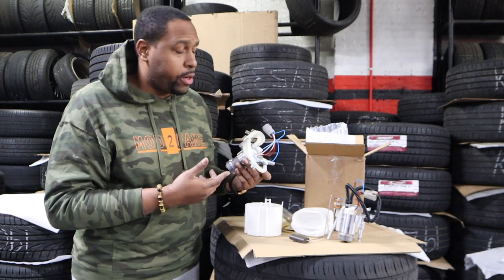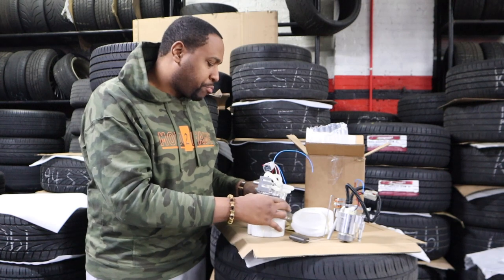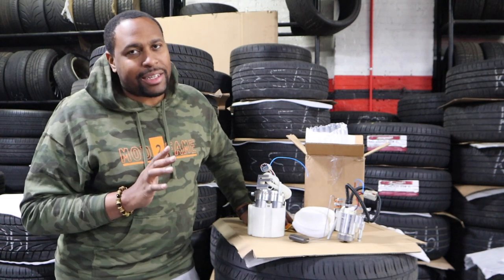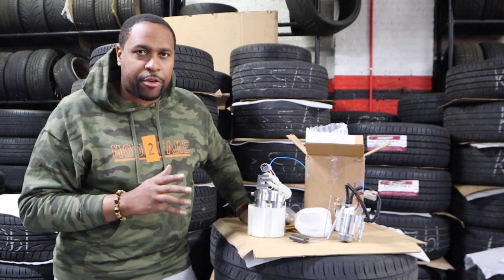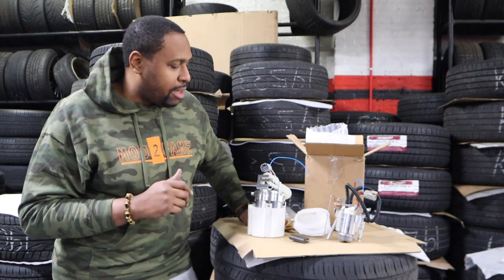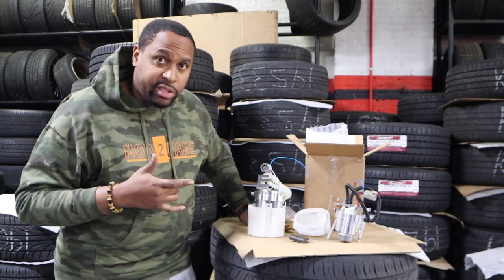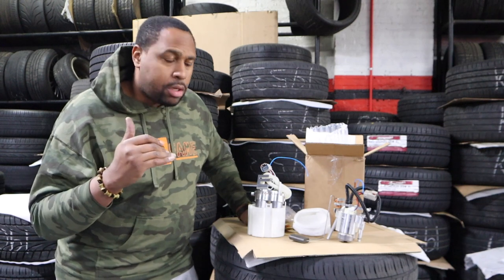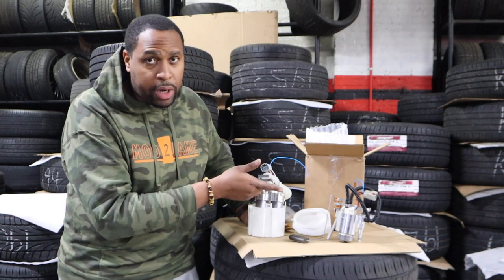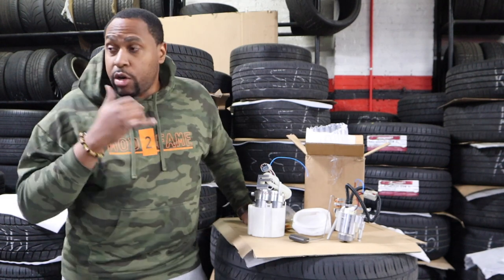Will we be able to flow 1200 horsepower? I don't know — 1250, 1300? I don't know. My turbos are capable of it. My motor is supposed to be rated to that level — Steve White just tends to rate things conservatively. I got my 426 bottom end from him rated at 1100, and I've been over 1100 multiple times. We're going to test the limit of these 295 pumps, starting where the old ones left off at 20 pounds of boost, then moving up to 21, 22, 23, 24 on the dyno.